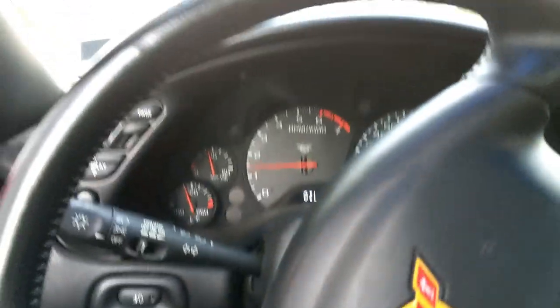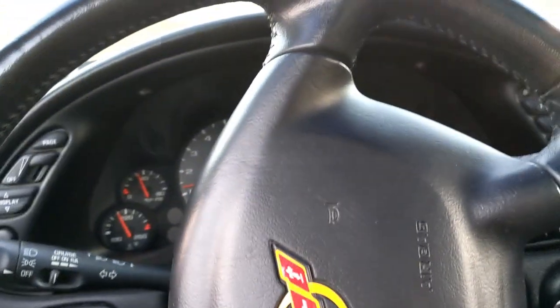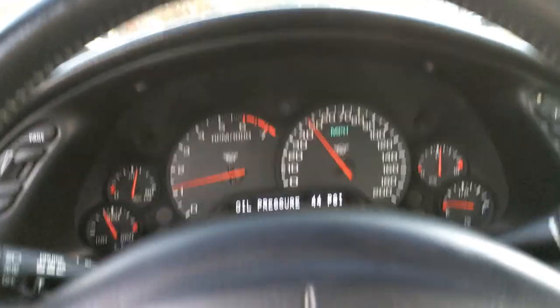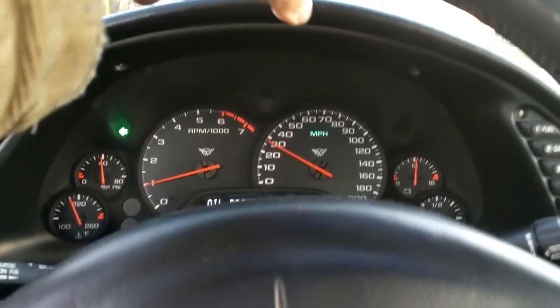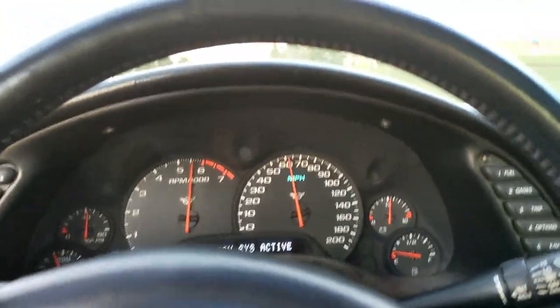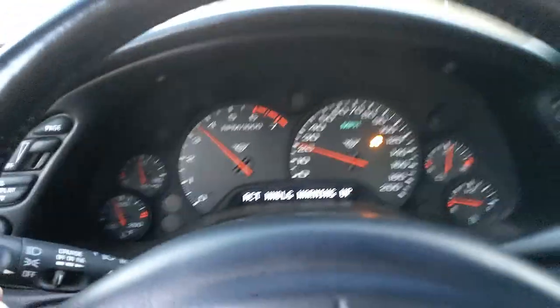I can't help myself — we're going for a little ride real quick, just to feel how it does on higher boost. Okay, we've got some shift point tuning to work on. Holy shit! One of the things I noticed out on the street was that the converter sucks. It's totally trash — we kind of figured that on the dyno because it wasn't making any power, but when I locked it up it really picked up. On the street it feels the same way — it feels like the converter is giving up at like 200 horsepower unless it's locked.